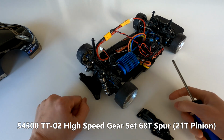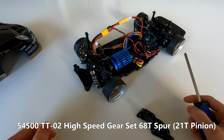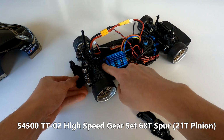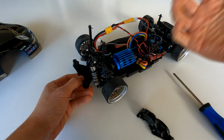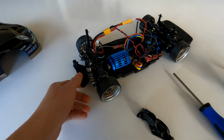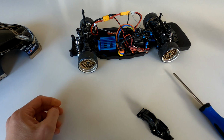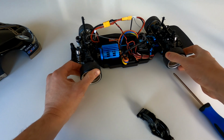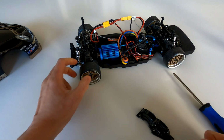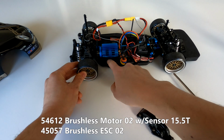You want to use a high gear ratio. Sorry, actually that means a lower gear ratio. Anyway, like an 8.5 or above. So a lower gear ratio gives more response. So when you're using the throttle, you have a lot more feeling, and if the gear ratio is too high, the car will become too twitchy. It's just generally harder to control the throttle, but with a lower gear ratio, you'll be able to control the throttle a lot easier.